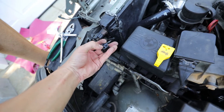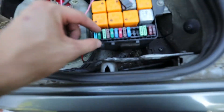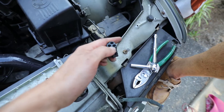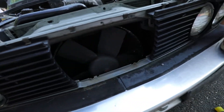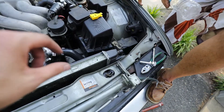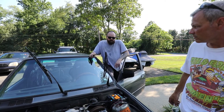These two being grounded is the high speed, which when at a higher temperature will short those pins. That goes through a different fuse down here — a 30 amp fuse — and that just makes the fan spin at a high speed. If you can't find a new thermoswitch temperature sensor locally, what we'll do is just short these two pins and keep this plugged in so it doesn't leak. Any time you turn the key to the on position, this should turn on high speed, and then the thermostat will control the engine temp to keep it at operating temperature. In the meantime we can use this to burp the system.